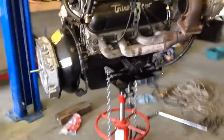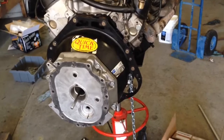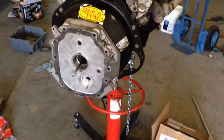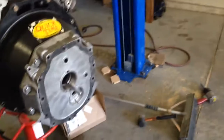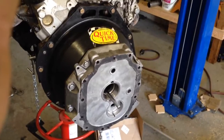Don't be intimidated to take off the front plate to do this setup — it's well worth the time. It'll save your clutch and save wear on your transmission internals, because misalignment changes the angle that the input shaft rides on the mainshaft. This motor is a turbocharged 347, making around 600 horsepower at the motor and just over 500 at the tires. Any questions, send me a message and I'll reply — thanks.